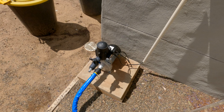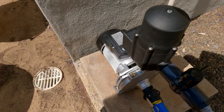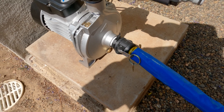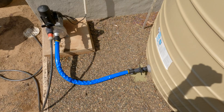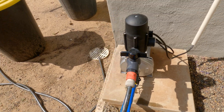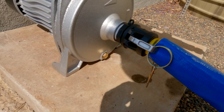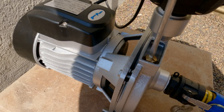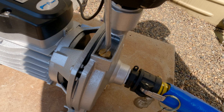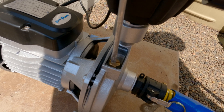Now we just need to plug it in and hope nothing explodes. Before we do that, we need to prime the pump. I'm going to put the water on and undo this bolt here and release any air bubbles that might be lurking around. I'm going to turn on the water and check for some leaks. Okay, the water is on — looks fine. I'll do this just to see if there's any air bubbles — release any air. Okay, looks good.